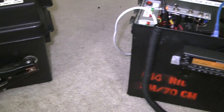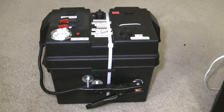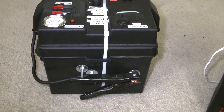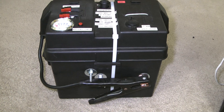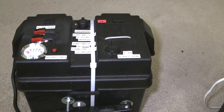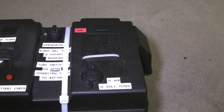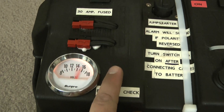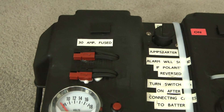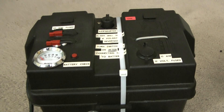What I did to complement the GoBox was build a jump-starter pack from parts of a previous jump-starter I had. I bought a battery box at Walmart along with a deep-cycle marine starting battery — so it's kind of a combination starter deep-cycle battery. Under this zip tie is the chip with a reverse polarity alarm from the old jump-starter and the power switch. There's your grounding cable and the positive cable is on the back side. We've got a volt meter here for battery checking, and two Anderson power poles fused for 30 amps each. You can connect that to the GoBox, which we're going to do.